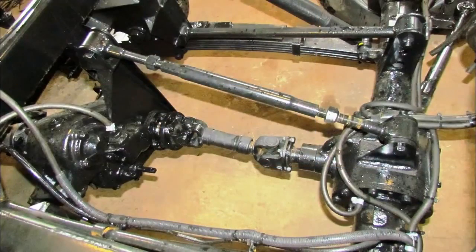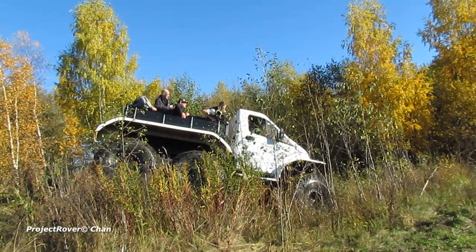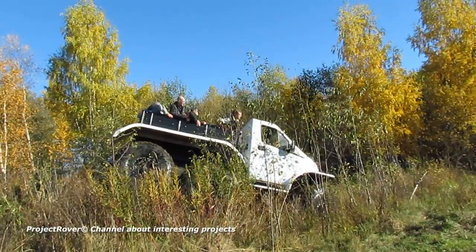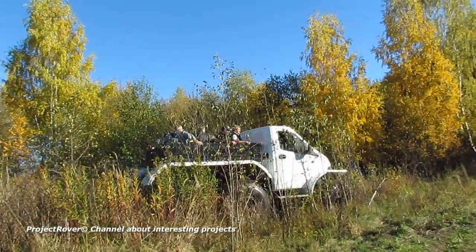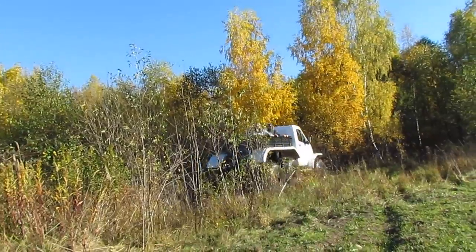The second transfer case is made swinging on additional hinges built into the rear spring balance wheel suspension. This transfer box can change the angle of inclination in the transverse plane following a change in the position of the rear axles. Accordingly, the angle of inclination of the cardan shaft also changes, which, moreover, can become longer due to the use of splines. This design solution is patented.